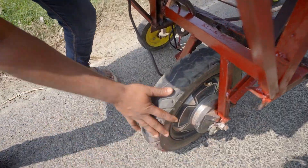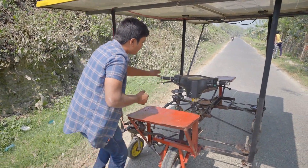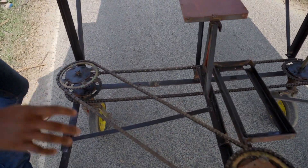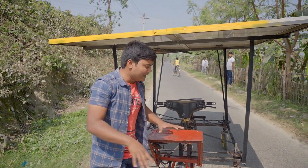This wheel has a motor fixed inside — only this wheel is powered by the solar panels. The rest of the wheels are rolling by the force applied by this wheel. This is the mechanism of the handle: when I rotate the handle, the front two wheels rotate. It has only two seats because we have to keep it lightweight.